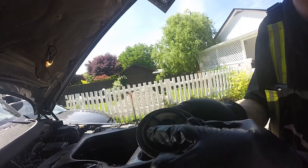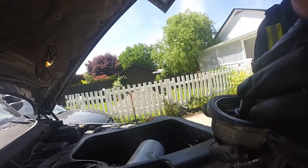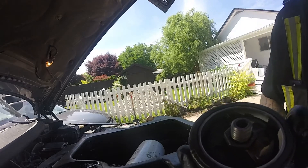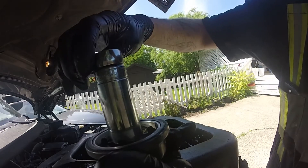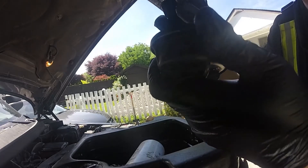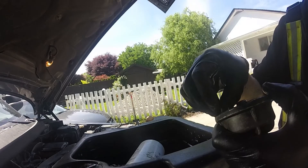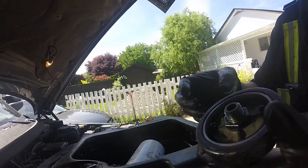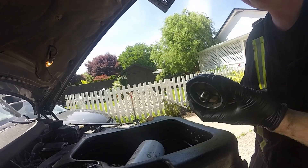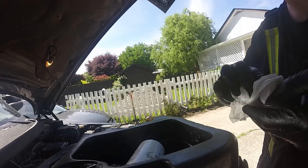Put the pieces back together and there's this little nut — not a castle nut but just a nut — with a 15mm socket to tighten it down. We don't really want to tighten it too much, just a little turn — no pressure, we don't want to damage this. I couldn't get any o-rings with this, so you'd probably have to go to Cummins. Make sure you get the o-ring kit from Cummins, your Dodge dealer, or someone else that sells these fuel parts — don't be as unprepared as I was.